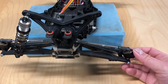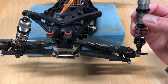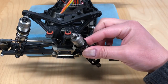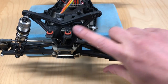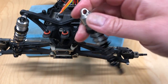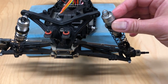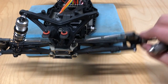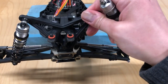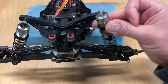So what does this have to do with shocks and shock locations? There are basically two rules at play when you move a shock around. Rule one: if you move the shock closer to the fulcrum, it's going to feel softer because it won't be able to resist these arms and the shock tower quite as well — the little spring provides some force, but won't push back as well. If you move it out and further away from the fulcrum, it's actually going to feel a little bit stiffer because the arms aren't going to be able to push as hard on the shock. Closer is softer, further away is stiffer.